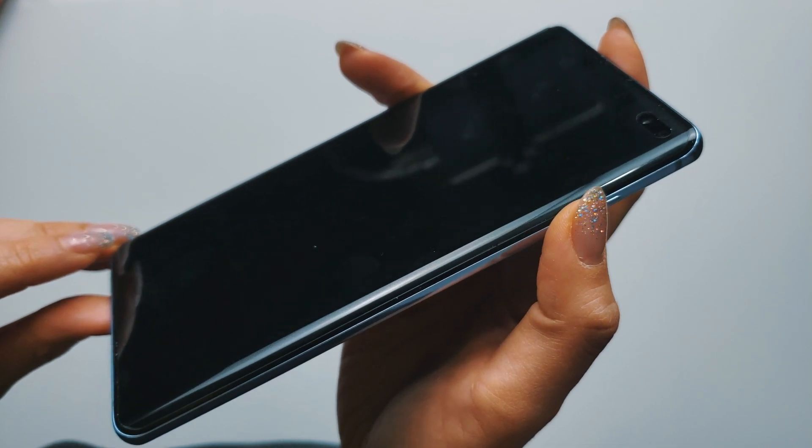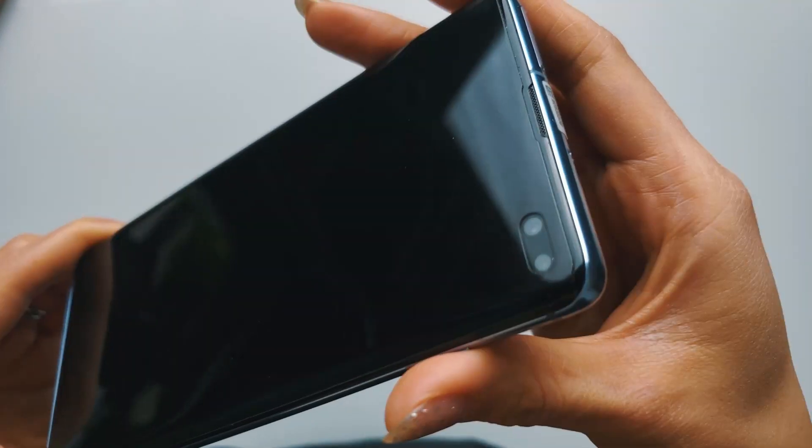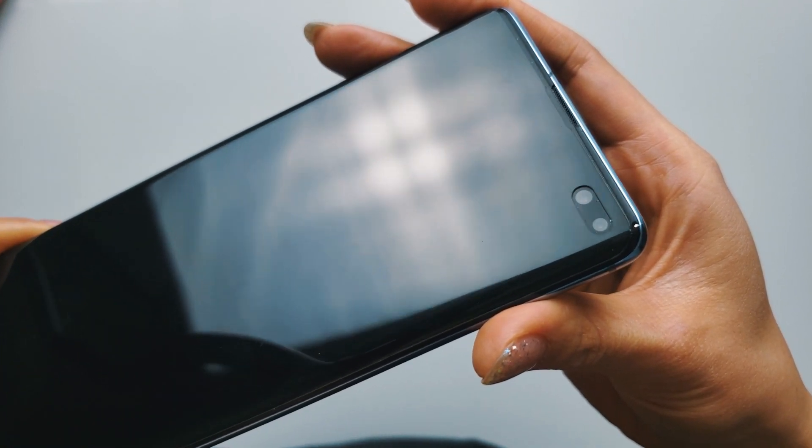Here's the result of my installation. I'm pretty happy with the install — I was worried that the liquid glue would spread over the camera cutout, but it actually spreads around it. Just make sure to wipe off any glue that might have spilled over. White Stone Dome recommends that you re-register your fingerprints after attaching the dome glass.